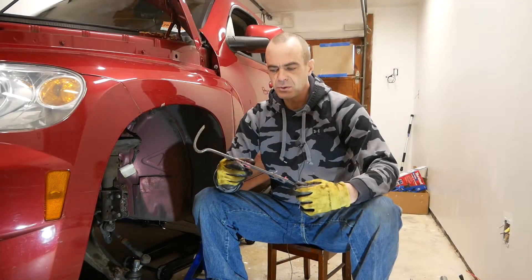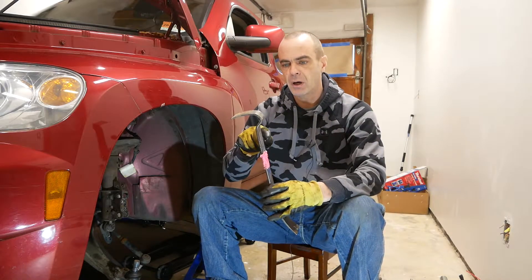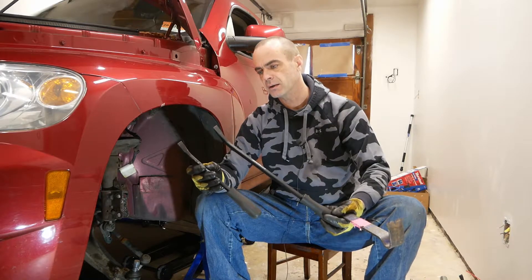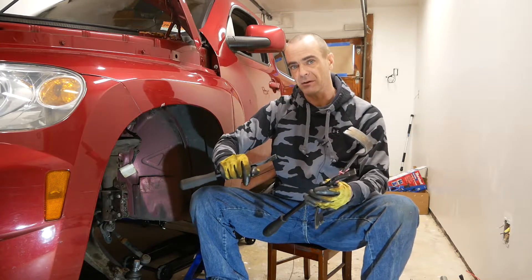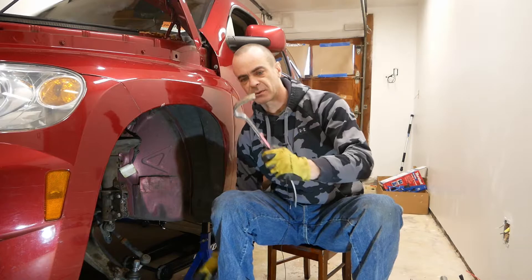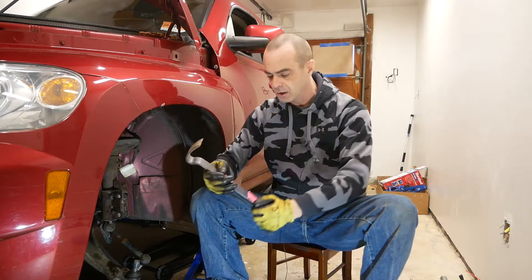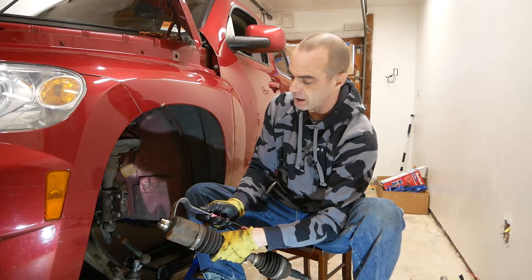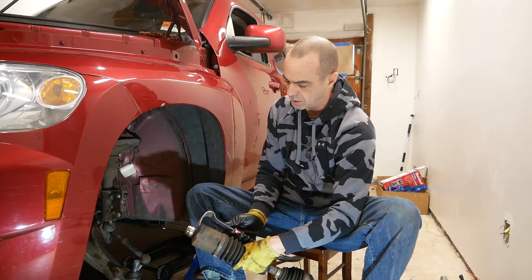This is the tool that I used — you can see it's not an automotive tool, it's more of a carpentry tool, but the main point is that it's got this little hook on it. What I found is that trying to use something like a standard pry bar is really difficult to get in there or behind it, because you need to pop it out. So having something with a hook — you don't have to use this particular type, any pry bar with a hook — and basically what we're trying to do is get it behind here and use the transmission itself as leverage to remove it.